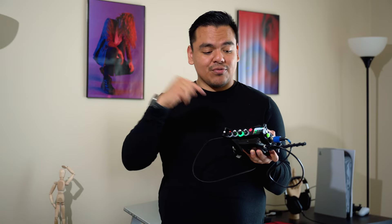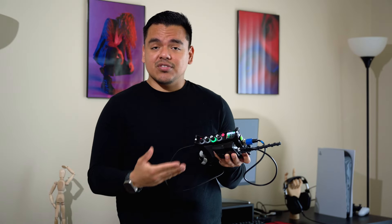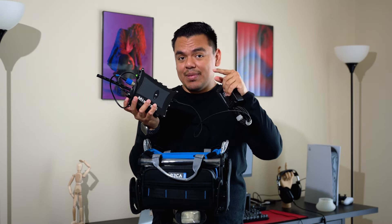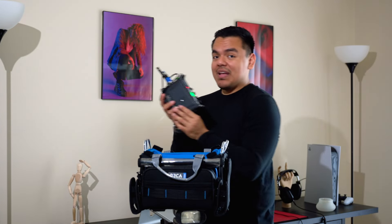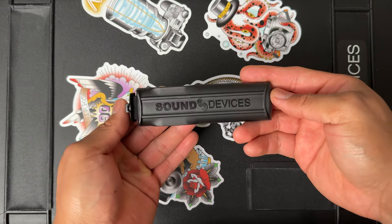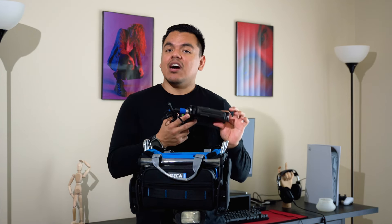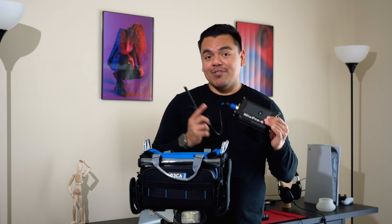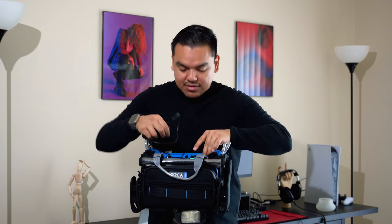I really love how small and powerful this mixer is. I think I got into the audio game at the perfect time where technology has advanced to where something like this is super accessible for the price. I absolutely love my Sound Devices mixer and I would buy it a hundred times over. Something I really love about the MixPre series is that you can disconnect the power accessory and not worry about the device powering off, because on the back of the MixPre-6 there's a battery slide that holds AA batteries — it acts either as your main source of power or as a backup, allowing you to hot-swap batteries while recording.